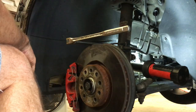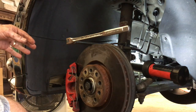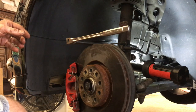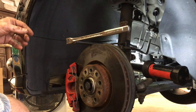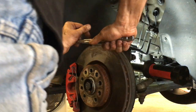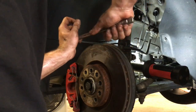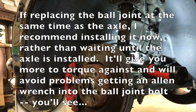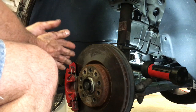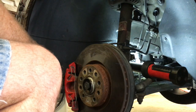But you can hold them. But if I was doing head gaskets, no way. If I was having to do the stretch on those bolts, I would definitely use a gauge. This can be a little less scientific than a head bolt. Using good tools, you do not want anything to snap when you're pushing on them that hard. That takes quite a bit of pressure.